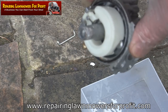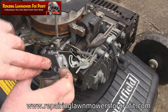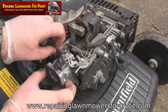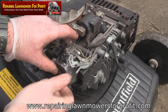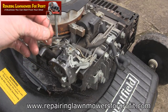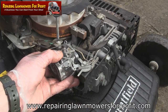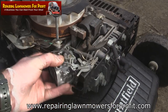We'll put the bottom back on this carburettor and hook it back up on the mower. Don't be fooled — it's easy to think the gasket fits on the back, but it actually fits against the air filter box. I've done that a few times. I'm going to hook this back in, sit it there, push one of these bolts back through so it doesn't drop, then put this linkage in. I'll put the longest end in first and hook it back through, push it back down through here, and that seats correctly.